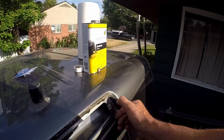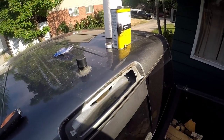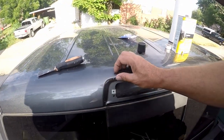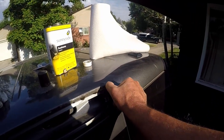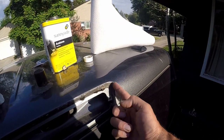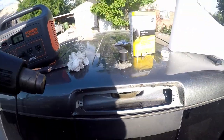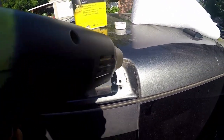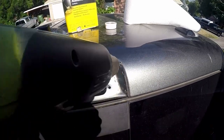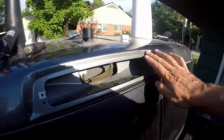Anyways, don't use hot glue. Oh look at that — it's actually softening up since the sun's come out. So onwards and upwards, I'm gonna keep getting this cleared up. I'll have to clear the back side of the lens as well. Since this feels like and looks like it is hot glue, I'm gonna go ahead and add a little heat — don't want to get too hot because I don't want to mess up the paint — but just enough to soften this up so it'll be easier to scrape off.